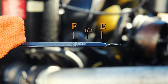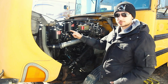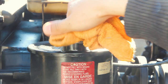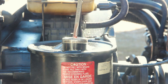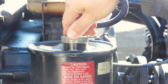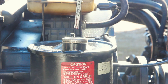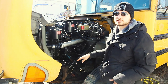For the power steering reservoir — in this case we have two of them — take the lid off. There's a small piece of metal attached to the lid that sticks down, acting like a dipstick. Pull it up, wipe it off, screw it in all the way, then unscrew and check the level. They flow downward so one may have more fluid than the other. Once again, check these cold, because when running, fluid pumps around and moves out of the visible area.